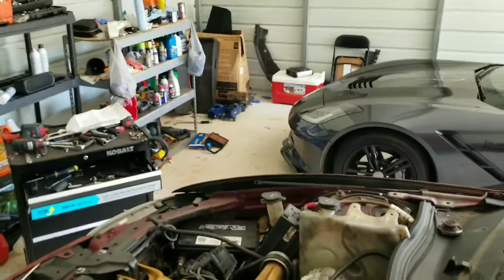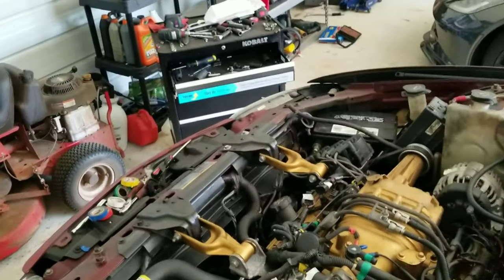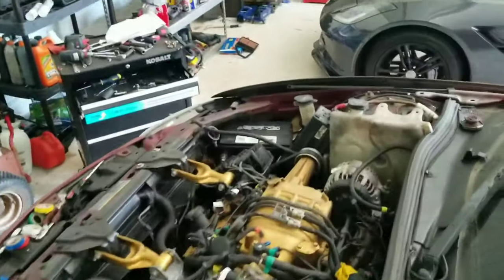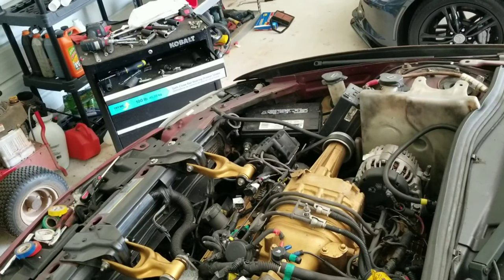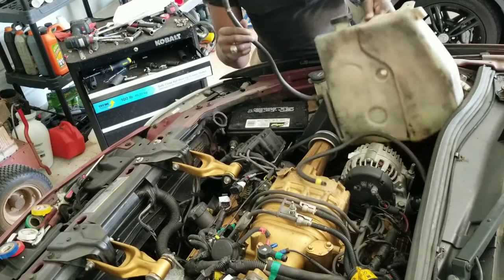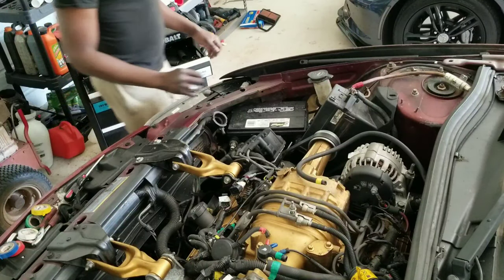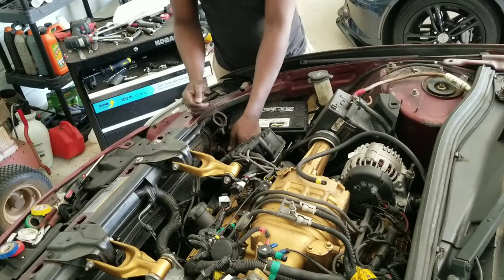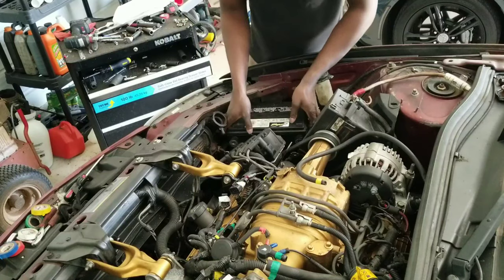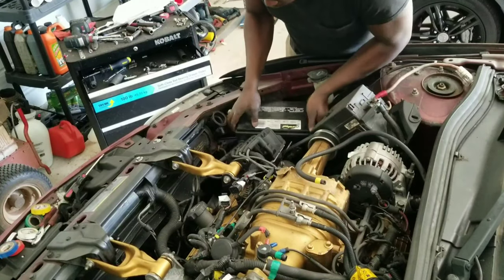So far all I have done is remove the air box. I also removed the radiator reservoir hoses and the reservoir. After that, I moved the battery — just take your terminals out and keep your screws somewhere safe. The electric box is probably going to be in your way, so just kind of tug it out of the way until you can raise your battery out.